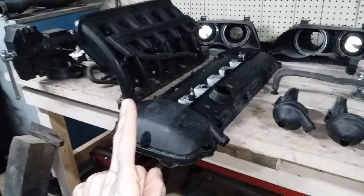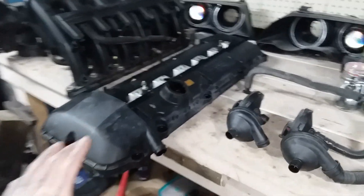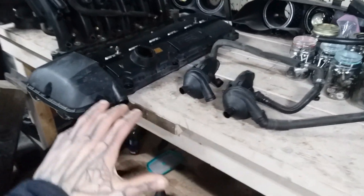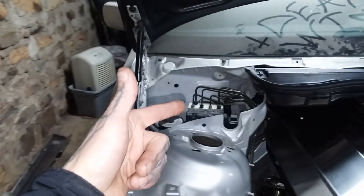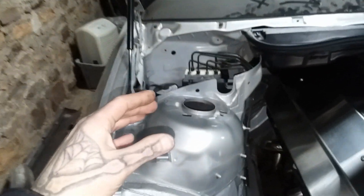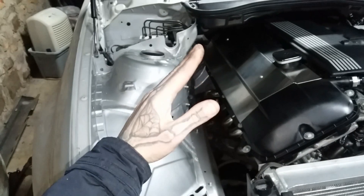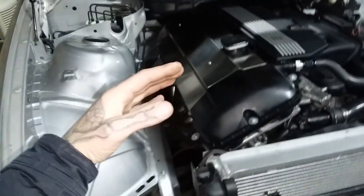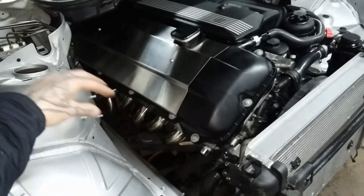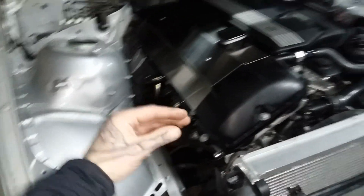I personally, when it comes to turbo, my cars get vented to atmosphere. Meaning I take a port from the valve cover — no smaller than three-quarter inch — put it to a catch can with a filter on it so it can still breathe to the air, because you cannot block that off. You cannot disrupt the flow, or you'll just destroy gaskets all the time. Or I'll simply put the hose to one of the fenders somewhere and dump it to the ground. I know it's not ideal but you have to do it somehow. One method that's not totally sealed — still going to atmosphere — is Mike Dodge on his circuit car using what's called an exhaust venturi evacuation system. He'll have his catch can with the hose leaving the valve cover, and the outlet hose plumbs into his race car exhaust with a venturi fitting at a certain degree where, as exhaust fumes are flying through the exhaust, it actually creates vacuum with the fitting.